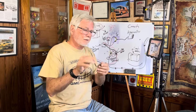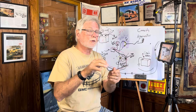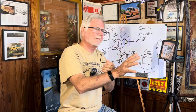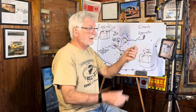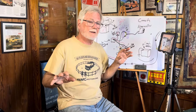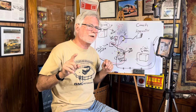To get it home, put this fuse link in there. To get it home, you can put a 40-amp fuse in there and have some extra fuses. Don't turn on your air conditioner, because the air conditioner is the second highest draw while you're driving down the road. If you do not use the air conditioner, you will not ever have a problem with this. So get a bunch of these and have them in the glove box. Headlights — do you have turn signals? Check all of your lights, because that's got to get you home. Our prime directive is to get home.